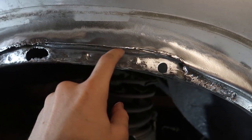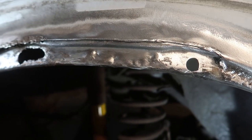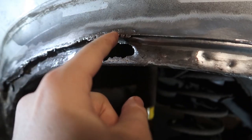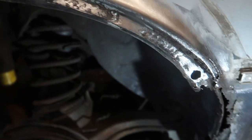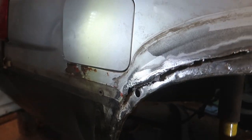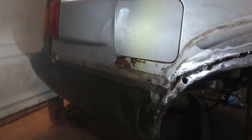This section right here is looking pretty darn good. I ended up cutting away the foam that sits on this ridge — there was surface rust because of it, and if I let it go it would have eventually eaten through this actually very nice hunk of metal. Anywhere it's bubbling or doing this kind of pattern needs cut out. Luckily the actual metal where the mounting stuff goes looks okay. My fear is the rust getting above these fender flares and really screwing it up.